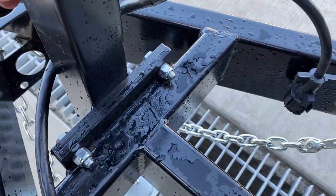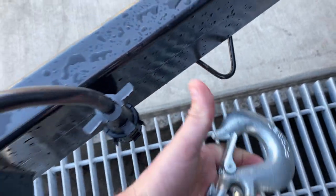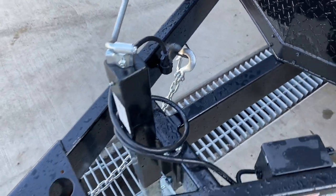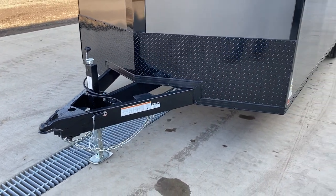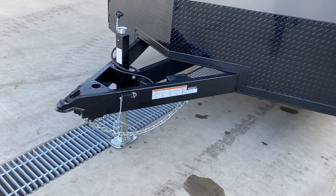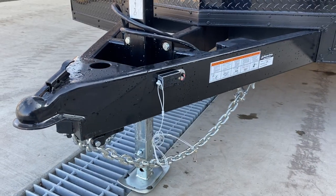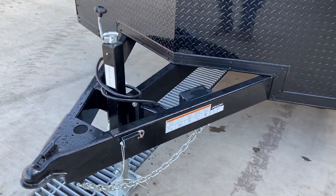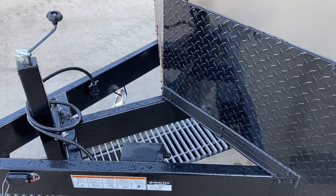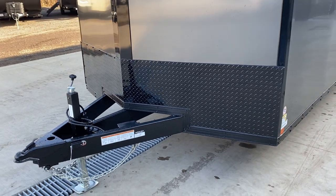Also notice that 7,000-pound jack is bolt-on instead of weld-on, so if you ever need to replace it, it's very easy to do so. Short Track also does a heavier-duty safety chain — more like what you'd see on an equipment trailer — with an integrated holder. The tongue on this is a 6-inch tube tongue. A lot of times in the industry you'll see a tube tongue that drops back to a 6-inch junior I-beam going back; this is tube throughout. It's capped on the end, which prevents acid rain, salt, and whatnot from getting in. The triple tube tongue instead of a traditional A-frame gives extra strength, going all the way back to the header with gusset plates tying it all together.